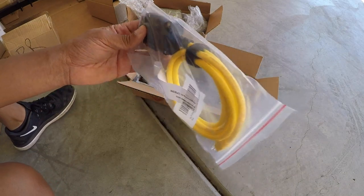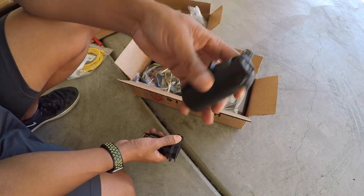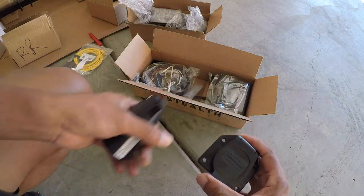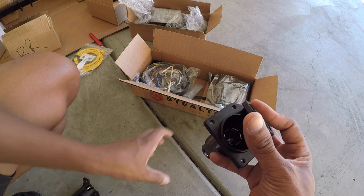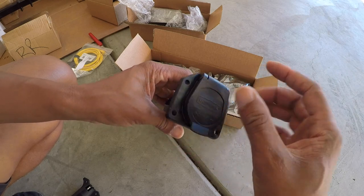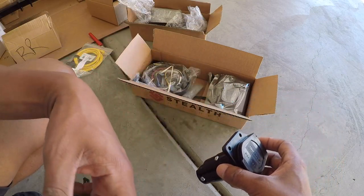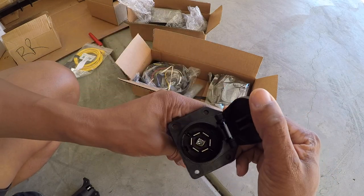Gives me a new cable for coding. You get your 7-pin wire harness, and you get your 7 to 4 pin conversion. What this conversion means, this is an RV style conversion. This is 7-pin, you have obviously a turn, brake. For 7-pin, I think there's a turn brake, there's one for charging. If you turn it to an RV, one pin could be for charging it, and another pin could be for backup. You have reverse lights on your trailer. One could be reverse lights.